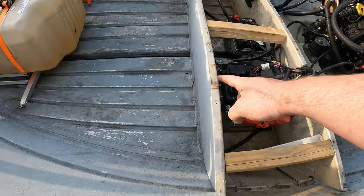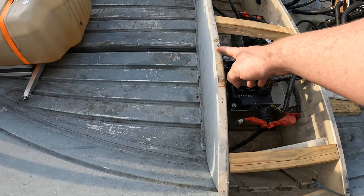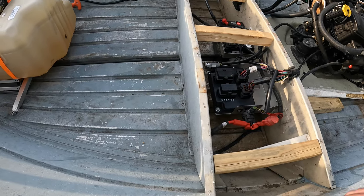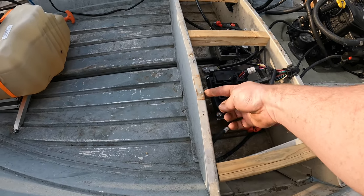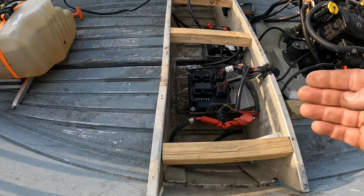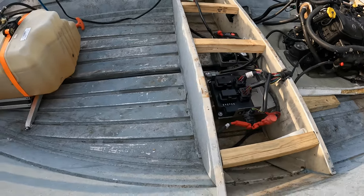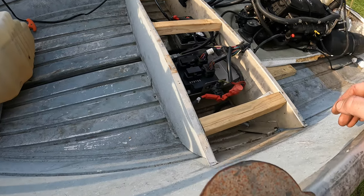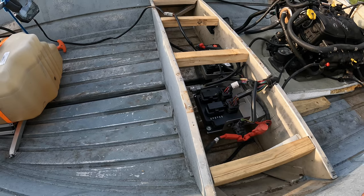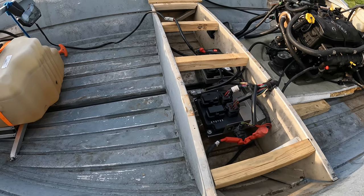I'm going to come back out with a hammer and a punch and knock all these old rivets out — they just sheared the tops off. I'll tap this down and push it because it's kind of bent back right now, as you can see. I'll try to straighten that back out, and maybe we'll upsize the holes and go with the 3/16th rivet. We shouldn't have any force put on that once we put a backrest on the back of the seat.